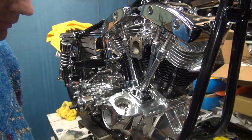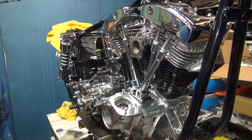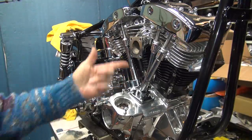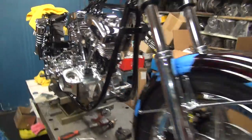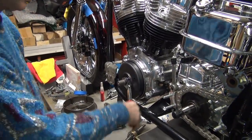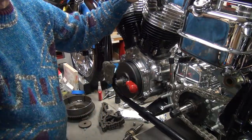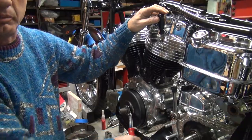So we're going to turn the motor over. Next time around, we'll be top dead center on it. We'll be able to do it. Now this valve here is going to open up, but it'll have a bunch of clearance in it. Okay, where is my other adjustment at over here? Alright, so we go back. We're going to be at top dead center in a second. Back up a little higher, you can see it. So there's top center, but we're on the overlap stroke.